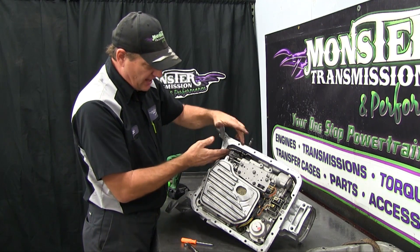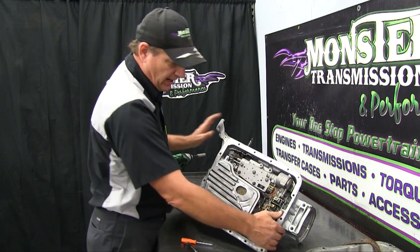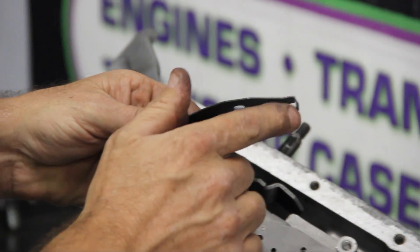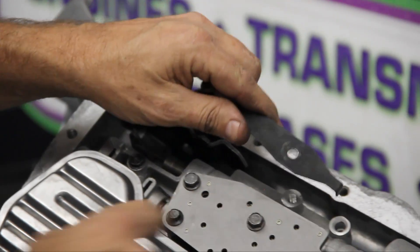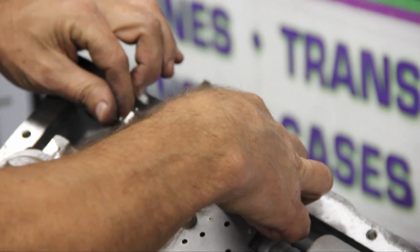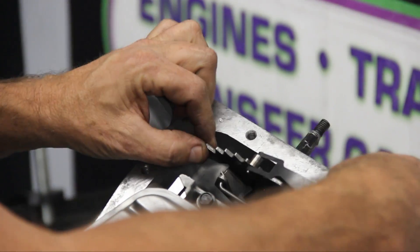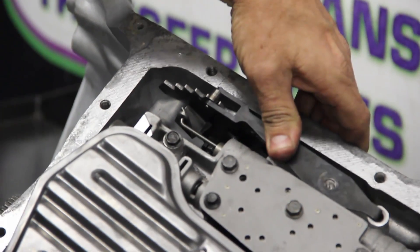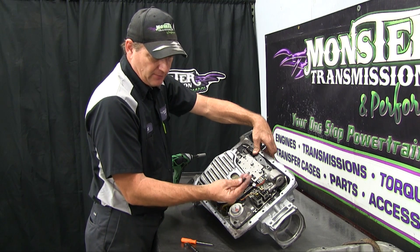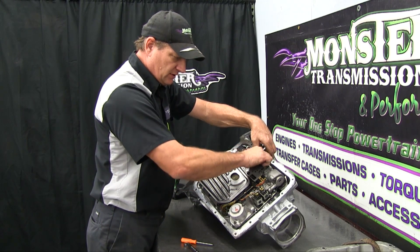Once the spacer clip is installed, the linkage has been installed into the case. We did not touch anything on the valve body besides the tensioner rod. Now reinstall the linkage tensioner — it has an L-shaped portion that fits down into the casting of the valve body. There are no threads there; the roller portion fits onto the roller tabs on the manual linkage. Depress the spring down and install the bolt. The bolt head is 13-millimeter, 8mm by 1.25-thread — same as the pan bolt for the transmission pan.